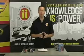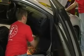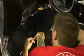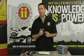We're going to be discussing the proper installation techniques for installing security systems and remote starts. We're going to show you how to track down those difficult wires using your digital multimeters and also some Techsoft software, which is basically a description of the location and the color where you can find those wires. And we're also going to discuss how those colors can't always be trusted.